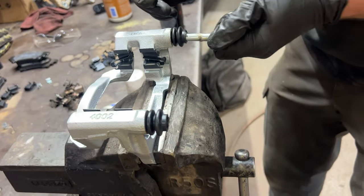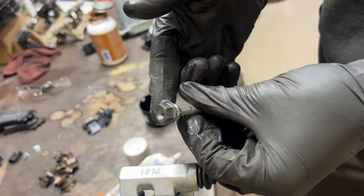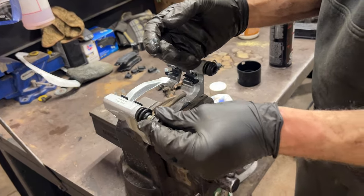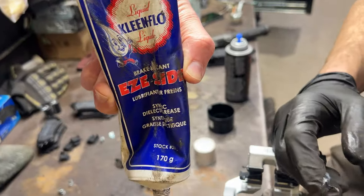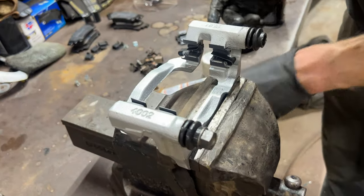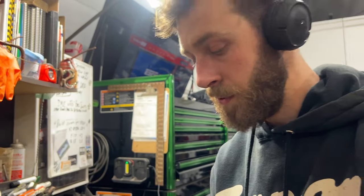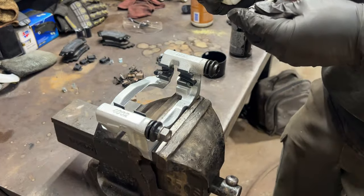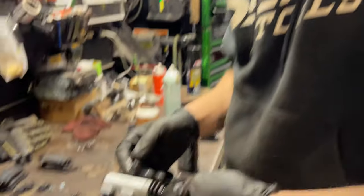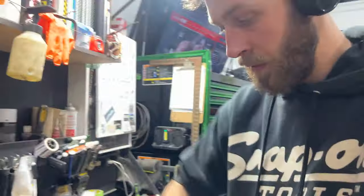I use the solid one to check to make sure everything's good — looks good. I'm going to put a little bit more lubricant on the edge here where the rubber boot seals against the pin. This is a silicone-based brake grease that also doubles as a dielectric grease. Do not use petroleum-based products for these slide pins because the rubbers have a tendency to swell up and the seal becomes compromised. Once compromised, moisture gets inside, rust forms, and the pin seizes. When that happens, the brakes sort of only use one pad. Everything's moving nice and freely — we're ready to install that onto the vehicle.